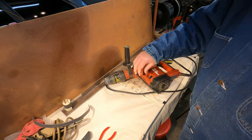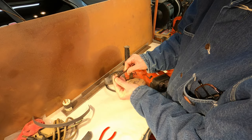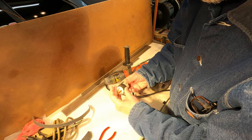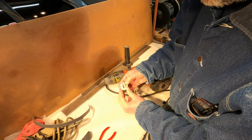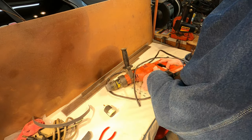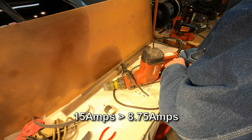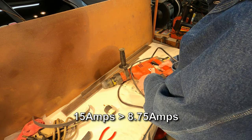The only other thing I need to do with this drill is put a new plug on the end of the cord. I have one of these caps — this one is Hubbell brand and it's rated 15 amps at 125 volts. This drill is rated 7 amps. For an additional safety margin, you can use 1.25 times 7 amps, which equals 8.75 amps. So this 15-amp rated plug is more than fine.